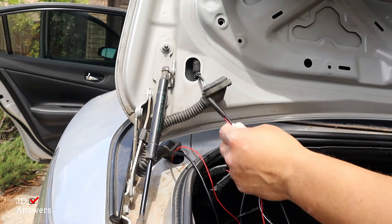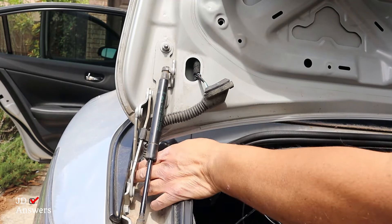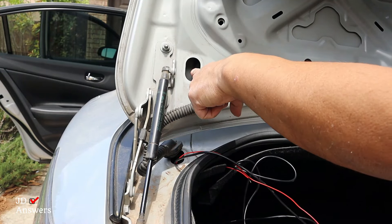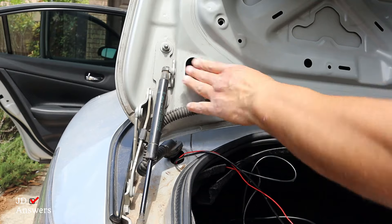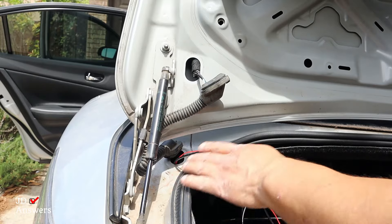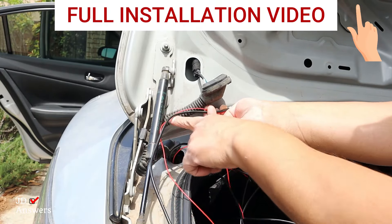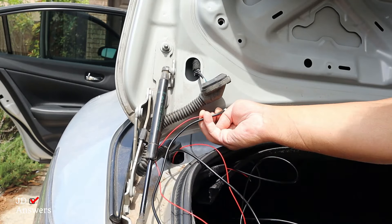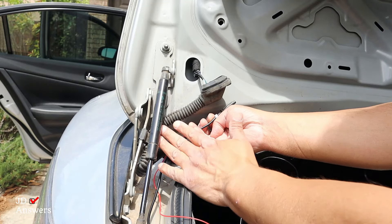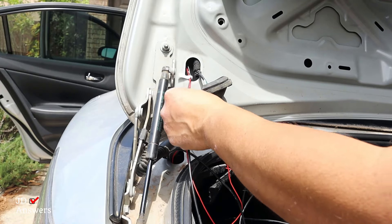That's how I got the wire — then I can go inside this outlet. There are three ways to do this: you could go inside from one area to the next, which is a little harder and might need WD-40; or you could black tape the wire to the wire harness; or you could zip tie it. I'm going to zip tie it because I do a lot of dash cam installations and I know I'm going to remove this eventually. I'm simply going to route the wire to continue it from the top.